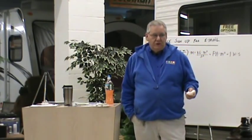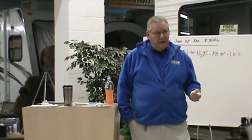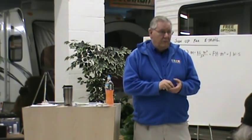Now, another thing too. Like you said, you got a lot of people on one line, 50 campers. Is it safe to use a 50 amp adapter plug? I got a 30 amp camper. So is it safe to plug into the 50 amp and it goes 50 down to 30? Yeah, because your converter is only gonna draw so many amps, period. If you're plugged into 50, your converter's only gonna use so many amps anyway. Well, when you got that many campers, you're not getting a true 120 volts. No, you may not be.